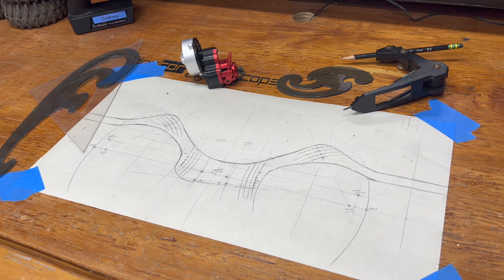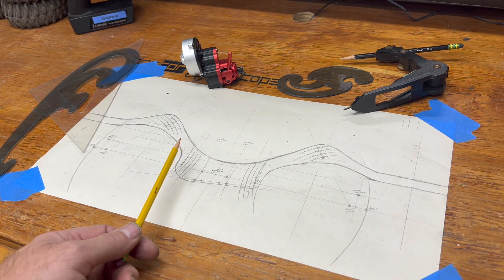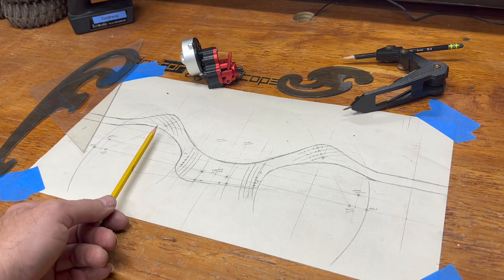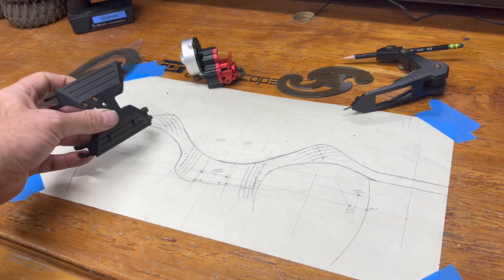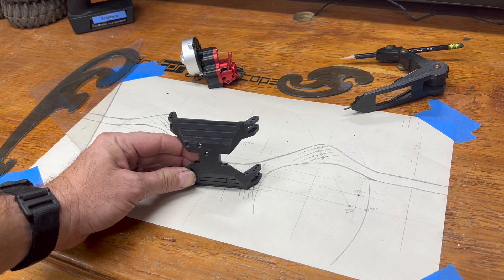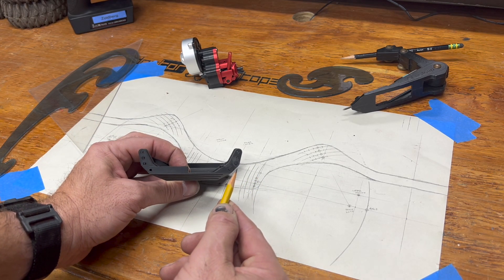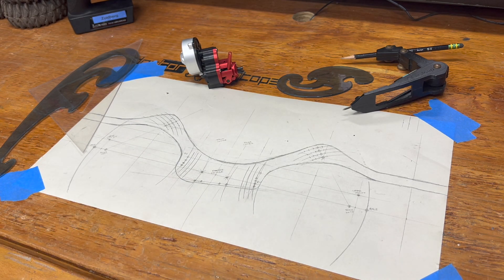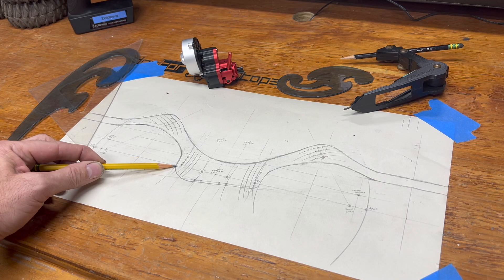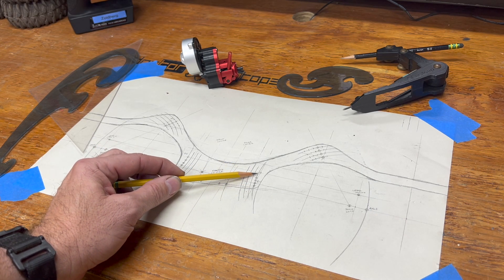Through the magic of editing, here we are — there are more lines and yet fewer lines at the same time. I was trying to keep the number of shock mounting positions to an acceptable, reasonable minimum. I think I ended on 16 in the front and 20 on the rear, which seems fine. I dug out the stock Capra skid and compared it to the LCG positions — the lower mount for the rear upper link is exactly lined up with the stock lower hole, and the upper mount for the front link lines up perfectly with the top hole. The marks will give me two lower and one upper alternate in the front, and two lower and one higher in the rear.